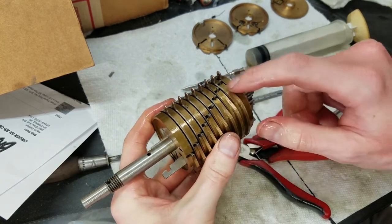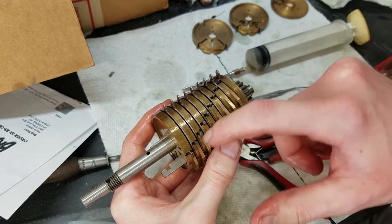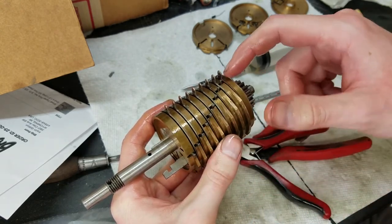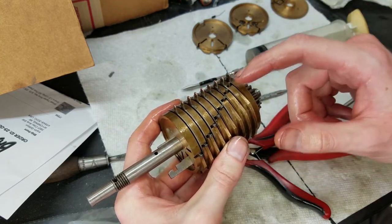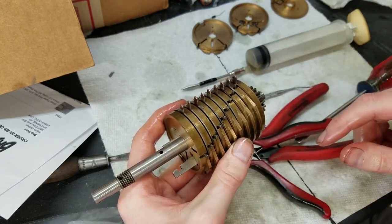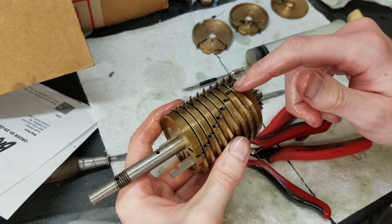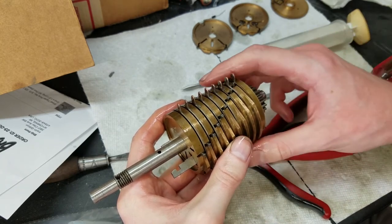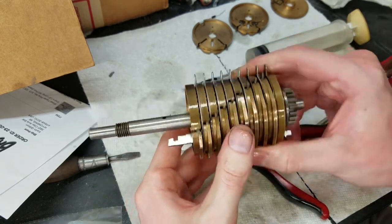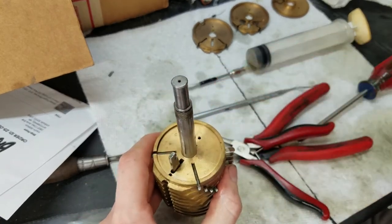And of course, these have to be staggered in the proper order, so if you mess up the order of one of these discs, then you won't have this nice helix type shape here, which will mess things up. These have to all happen sequentially. Because if you get a carry in this column, that might trigger a carry in the next column, so this carry has to be after that one. And if you mess it up, then you're going to start missing carries in some cases. So I think that's going to be pretty much good for that.